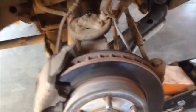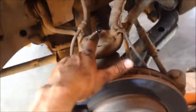Okay, so I went ahead and lubed those up. Again, all three. If you guys never lubed those, all it is is a grease gun, and you can get those for 20 bucks at Walmart even, or any auto parts store. Even the small ones they have, all the Zerk fittings are about the same. So you just go on top of there, push it down, you'll hear it snap, feel it snap, and just pump it till it's full.